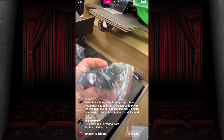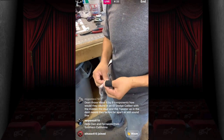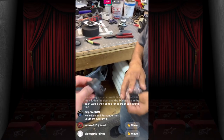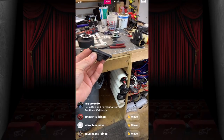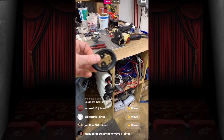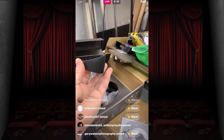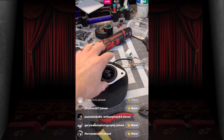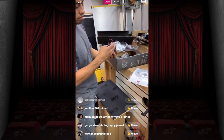It also comes with these flush mount angled brackets. Back in the day Honda Civics had this cool angled tweeter mount from the factory — Alpine used to do something similar too. These brackets let you angle the tweeter automatically when you mount it in the door, which looks great. It's the only current product I've seen do this. And then the cup bracket is what we're using for the mount in the back — cut the screw tips so they don't scratch.